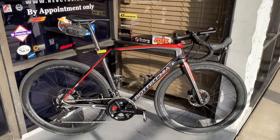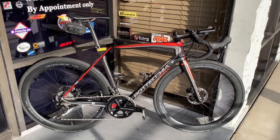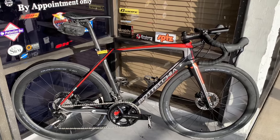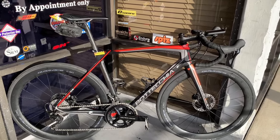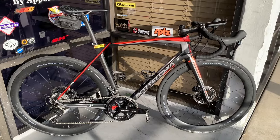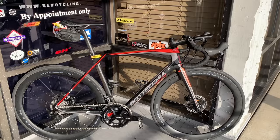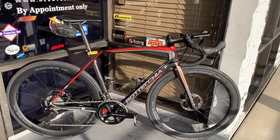This is a hybrid Frankenbike that anyone can do if they do not want 12-speed DI2. Just a recap: Dura-Ace level is only DI2, Ultegra level is only DI2, and 105 is available in both DI2 and mechanical — but only disc. So if you're a rim brake person, your options are very limited. SRAM is still doing Red and Force in rim brake 12-speed AXS, but with Shimano those are your options.